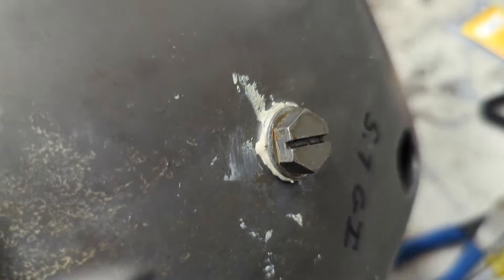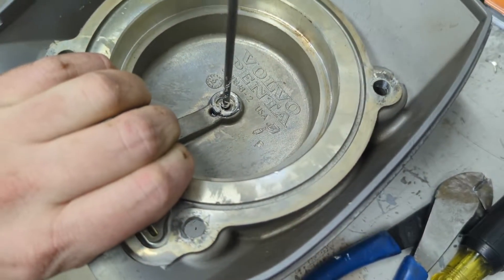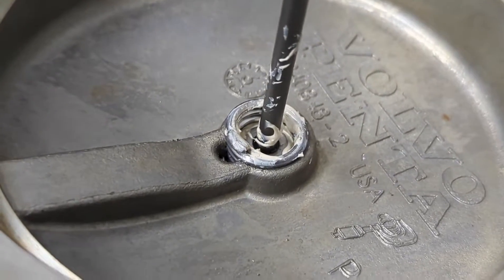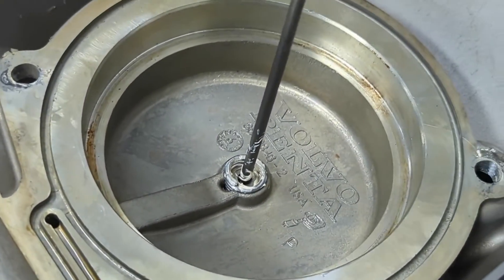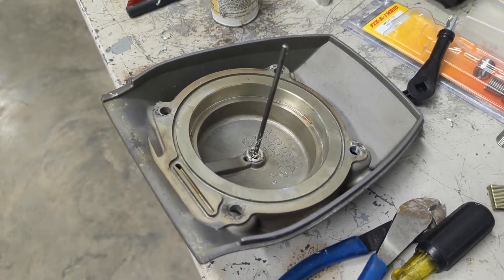You can see how this is sitting down — reasonably flush, looks like it'll be good. Our guess on the depth was good, and on the back side you can see there's a couple coils showing yet. We probably could trim off more if we wanted, but we're just going to try it. We're going to take the o-ring — there's a little o-ring that sits down in here — and just reuse that. We're going to go see if it fits and if it does, we'll be good to go.